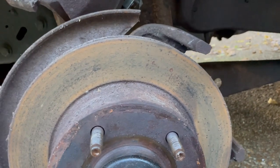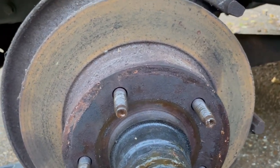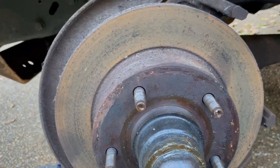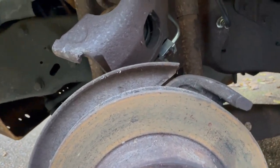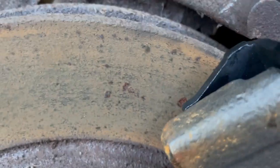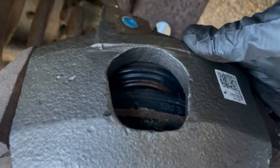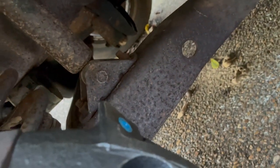With the caliper having the front pad already in it - remember it faces you - you just drop the caliper on. Remember that calipers are different left and right, so make sure you have the caliper on the right side. That fit in real good. The back pad is in, it's not upside down which is nice. This only goes in one way - in fact, to get one in upside down is really not an easy task.